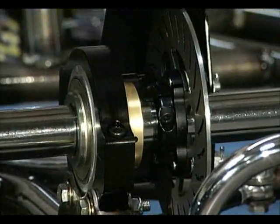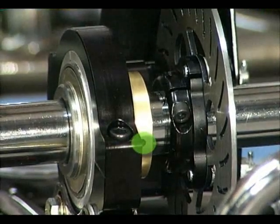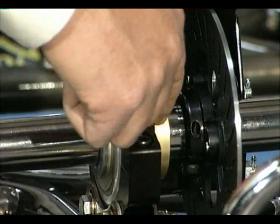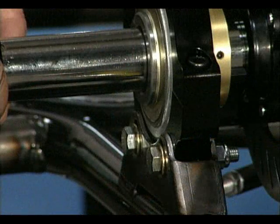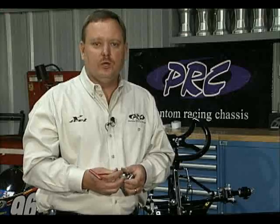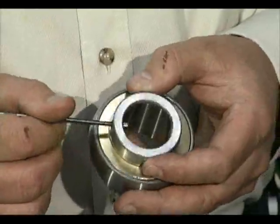On the left side, I always put a pin through the bearing into the axle. That makes the left rear solid without putting any axle collars on it. I simply pin the left rear bearing to the axle — I use a pin or a set screw turned down to become a pin. I just drill a hole in the axle where the set screw left a mark. I use a 13/64. Some people drill a quarter-inch hole and put a bolt all the way through. Just put a pin through one of the set screws going into the axle to pin it in place so you don't need any axle collars.